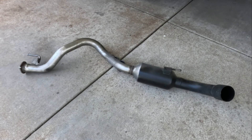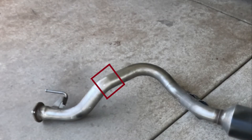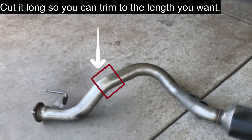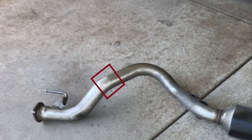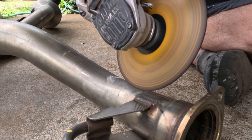The helper did not want to get filmed while removing this. Here's the delete on the tip and resonator — the exhaust dump option. Cut it back in this general area. If you just cut off the resonator and tip, reinstall it and you're done.